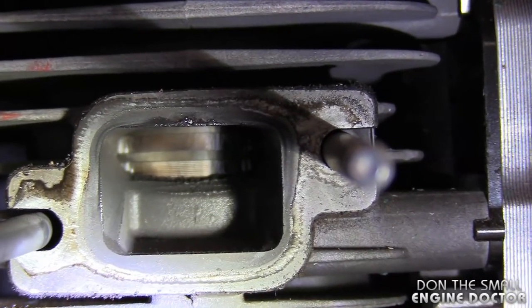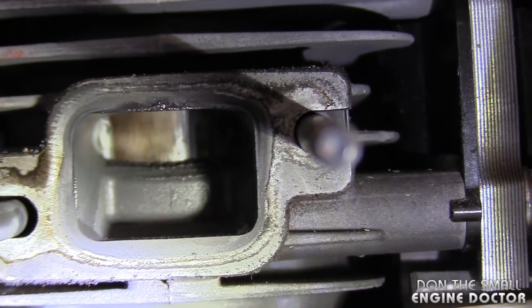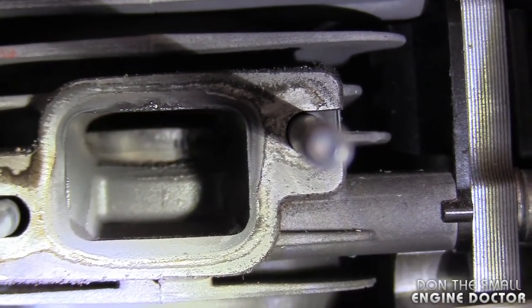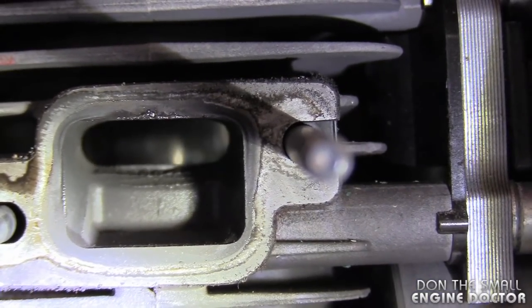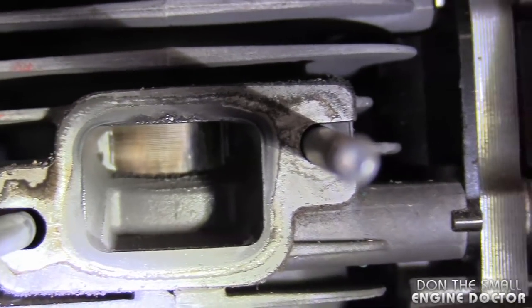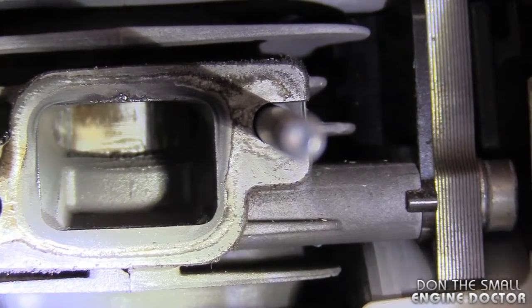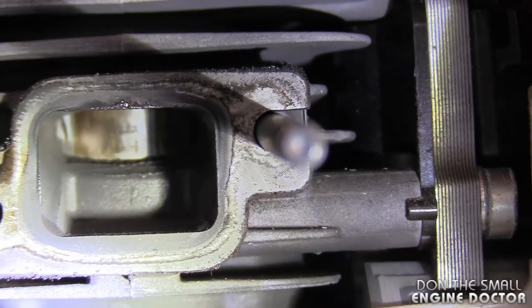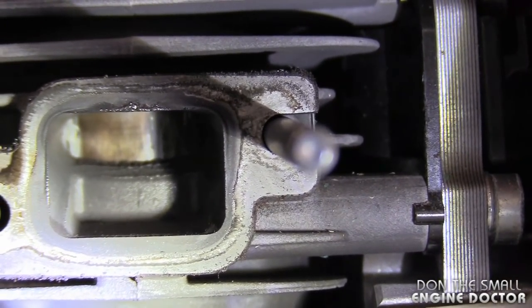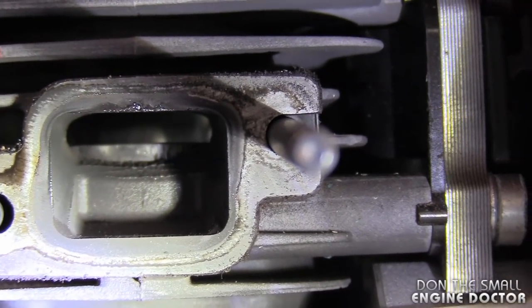All right, I can see some scoring. Pull it over a bit. Oh yeah, it's cooked. See that brown there Dave on the piston — it's got nice and hot, hasn't it. Yeah, that indicates it got hot. I mean, you can still see the factory markings on that piston. Yeah, well this saw was just bought last year. Wow, it's cooked. So that explains that noise — he must have been cutting some major stuff.